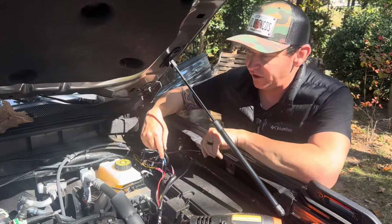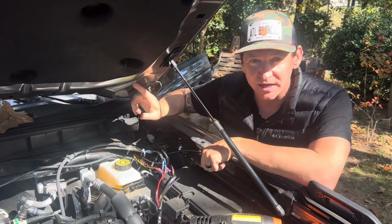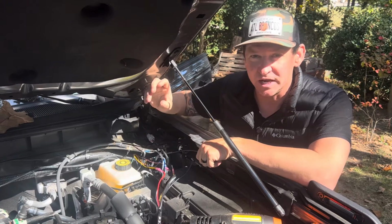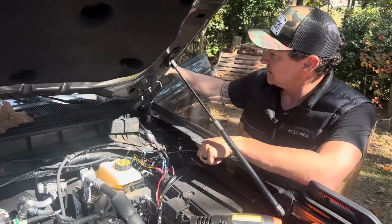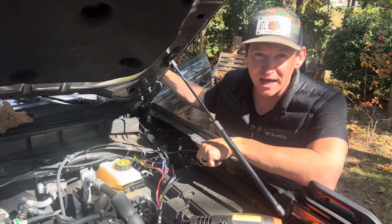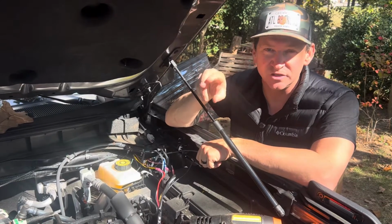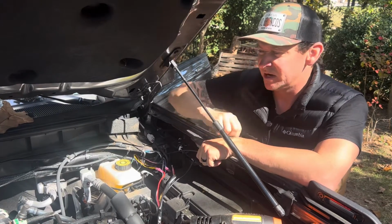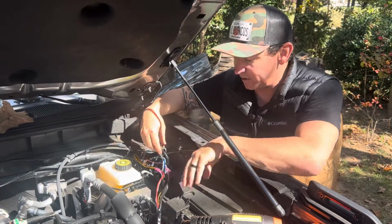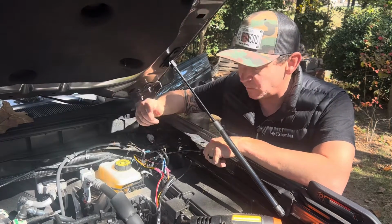And what I've done is I used the yellow wire for the main light switch. And then for the two clearance switches, I used a 10 amp fuse. Now I've got the ditch lights over here on the side as well that also have amber lights in them. So what I did was I put my two amber switches by each other and my two white switches by each other, just so I can just bam, bam, and be good to go. So all I'm going to do now is heat shrink these and ground this ground, and we'll be done.